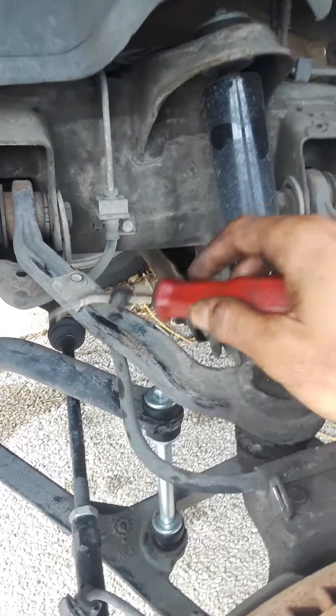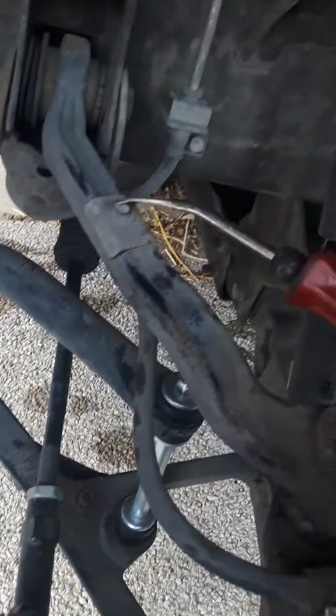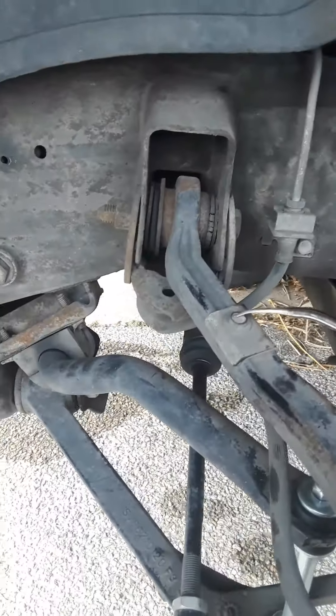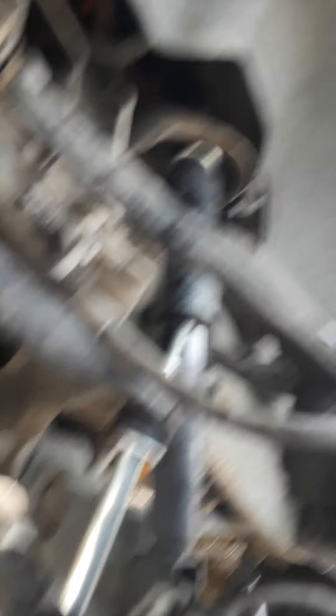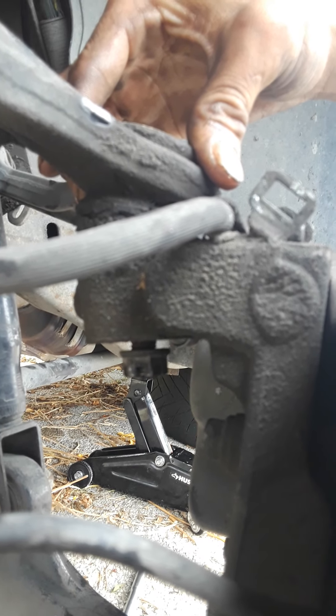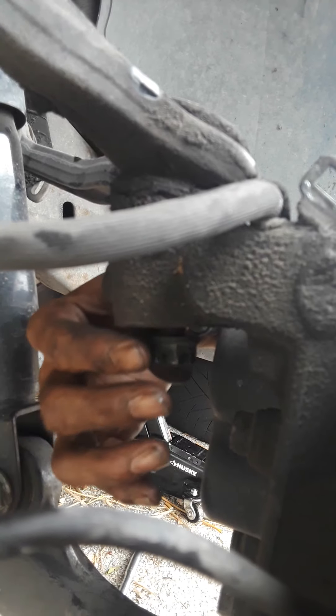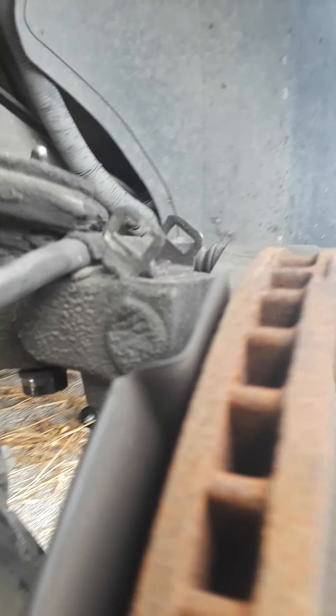I don't think necessarily this one - I think this one - that way we can move this bolt out easily. And that way when we take off the upper control arm, this is not still on. So that's gonna be a 10 millimeter bolt - grab a 10 socket and then take it off. I got the castle nut, and there also was a cotter pin on the upper control arm. The front part right here - I got that loosened. It's an 18 millimeter castle nut. You can use an 18 millimeter socket - there's enough room to get in here and use it. Loosen it up, then just put it on a little bit more.